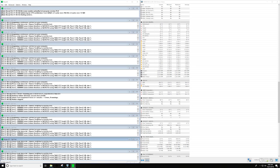Let's talk about motherboard temperatures. Luckily ASUS does have VRM temperature probes already on the board, so with something like HWiNFO you can monitor those. In the Cooler Master XB EVO case with two 140mm intake fans and the Noctua NH-D15, the VRM cooling solution is very effective — even while overclocked up to 1.34 volts on the Vcore, the VRMs are staying under 50°C at all times, including with ASUS AI overclocking enabled.